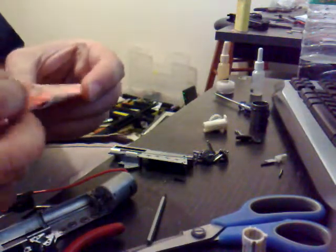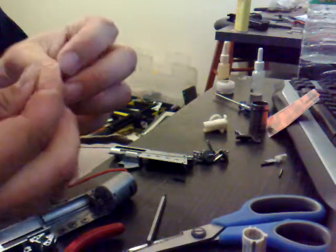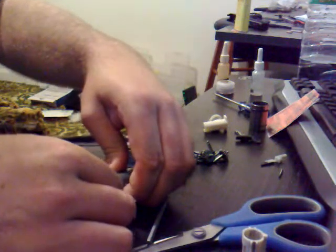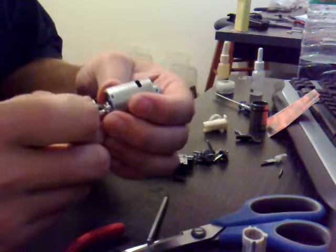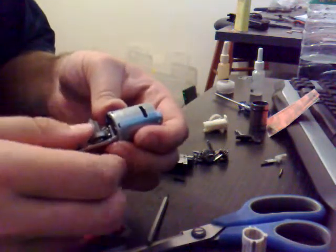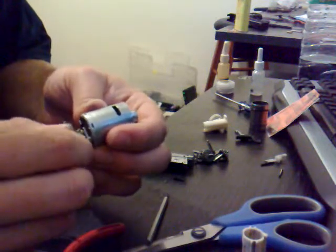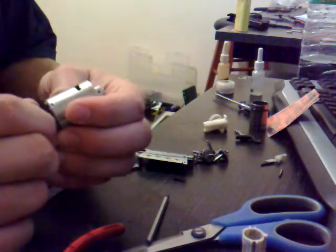I'm going to try another one. I hate this — I lose so many bits and parts when I do airsoft stuff. It's probably just down on the floor somewhere. Try to put it on there this time. Motor it up, just so we can edge that in there. Put the shim under it, see how it works with it now. That sounds — and that's the key really. It is an art, there's no rule to it. Every gearbox is different. Even TMs, which are usually a safe bet — there's still always a chance you could fit a set of Guarder gears and need to shim differently from your TM gears. You could fit a different set of bearings which are 0.1mm thicker than other bearings. So it's good to take each one on its own merits.